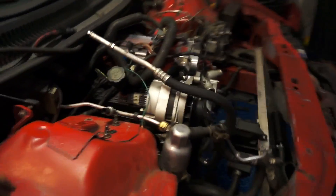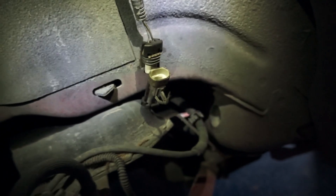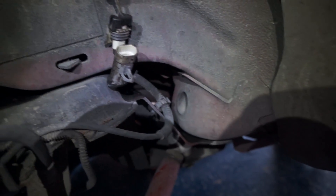I'm going to lower it down, take the remaining crossmember bolts out, and these should be the only thing left holding the engine in the car. I forgot to mention: on both sides, there are wheel speed sensors — you're going to want to disconnect those, because one side stays with the car and one side goes down with the K-member.